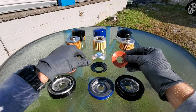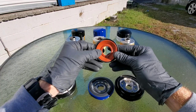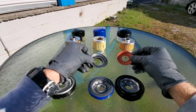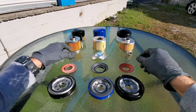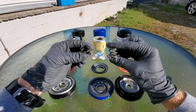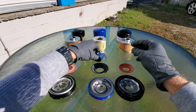However, the ACDelco anti-drainback valve is made of nitrile rubber — a much lower quality material that cannot handle the same extreme temperatures as the others. The anti-drainback valve holds oil in the filter, so even after you turn the vehicle off and start the car up next time, you still have oil in the filter and no dry startup.